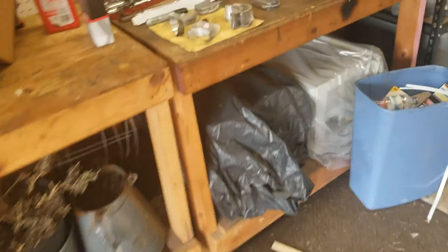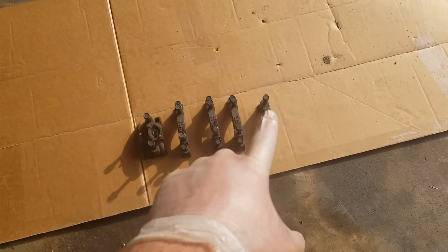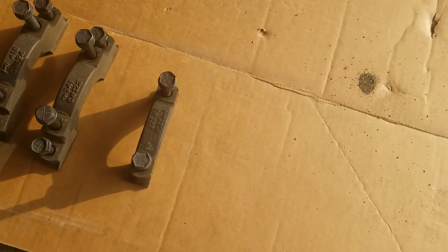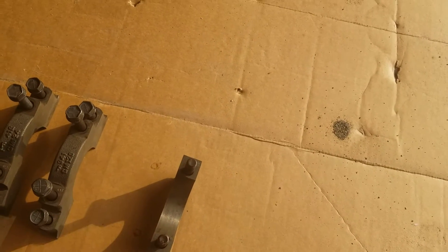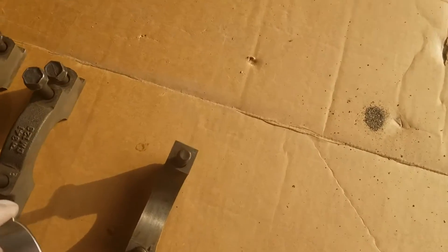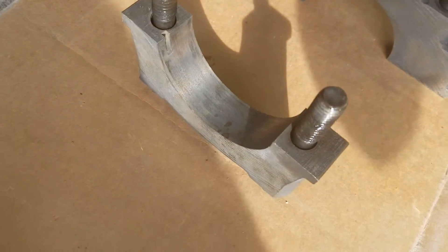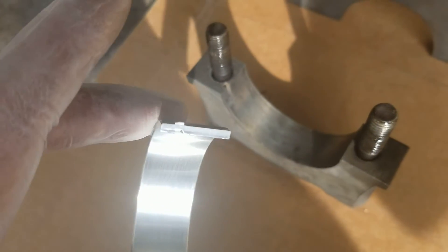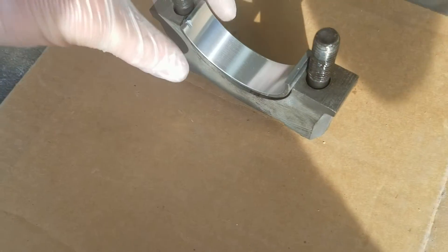When you put the ones from the top into the caps, you want to just set these into the caps. We've got all the caps laid out here in order from front to back, and you want to do the same thing with the caps laid upside down. You also want to make sure there's a groove on all of these. You can see the groove on the cap right there, and there's a groove on this side of the bearing — make sure those line up, otherwise they won't go in.